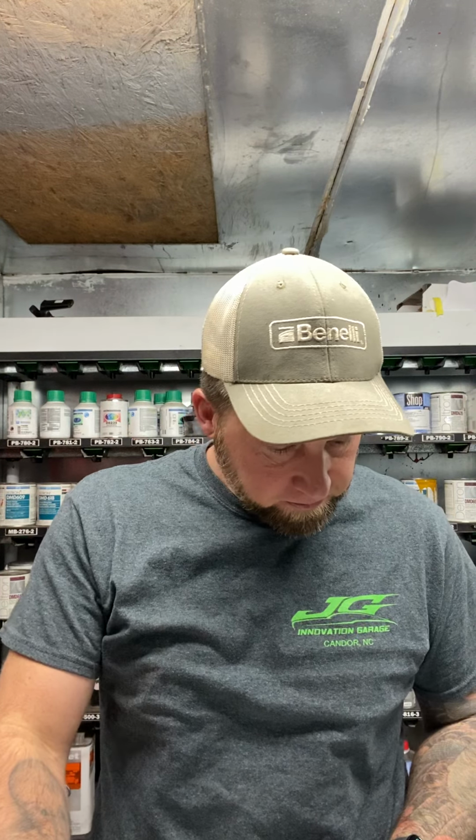So, here's the thing. To treat the bare metal, you can do several different things. You can spray epoxy on it within 30 minutes, a corrosion-resistant epoxy like CRE-321. You can put it on there immediately after you get through blasting. People say, man, it took me 12 hours to clean that car, it was so much sand and stuff. Well, I do it all dry. I don't do it wet because I had a bad experience with the wet. So I do it dry.